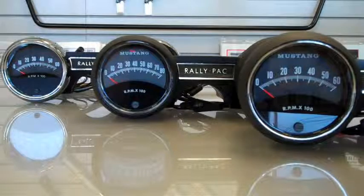After choosing an original style or the reproduction version depending on your ignition system, the next thing you need to figure out is if you want a 6,000 RPM or an 8,000 RPM. The 6,000 RPM is what normally came standard on most 289 cars. The 8,000 RPM was reserved for the Hi-Po, being a solid mechanical cam.